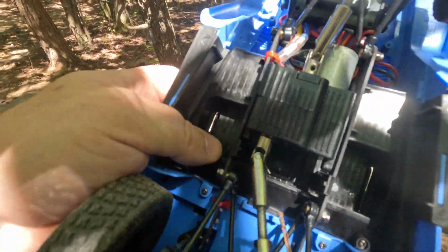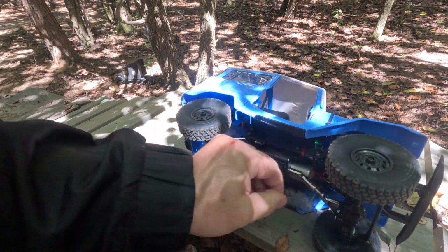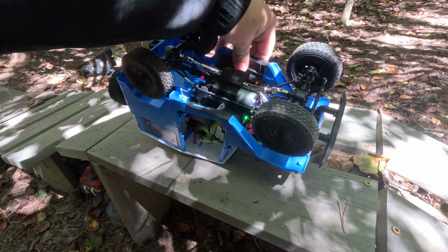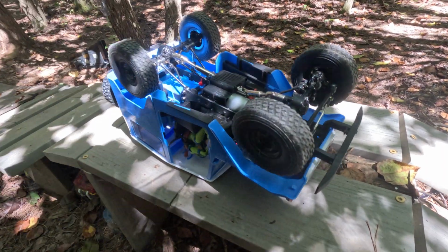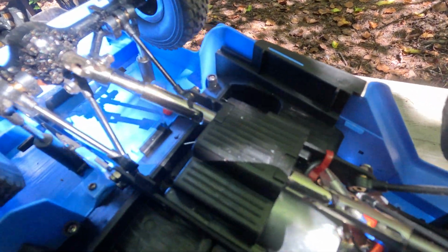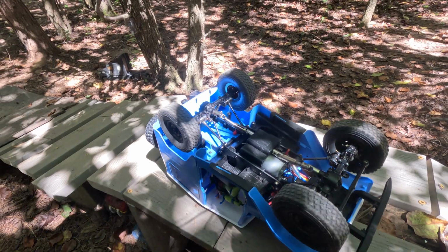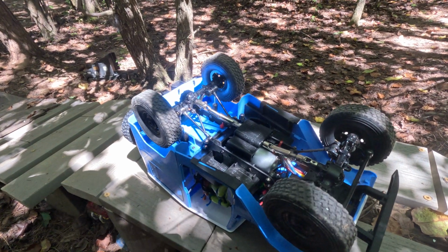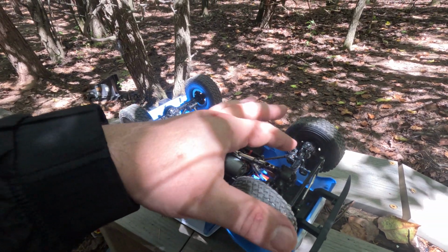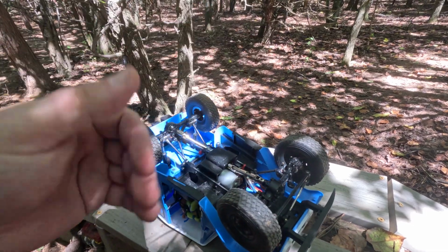And that's the 370 there, and it has counter rotating drive shafts, so that takes away the torque twist. Yeah, see, one rotates one way, one rotates the other. And that was nice. But in order to do this, since the thing originally wasn't made like that, I had to flip the front axle and just reconnect everything.